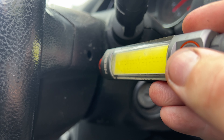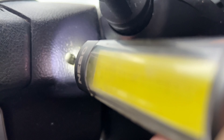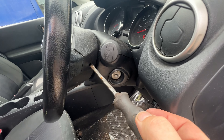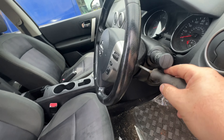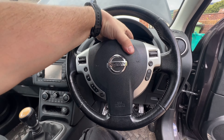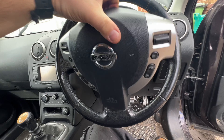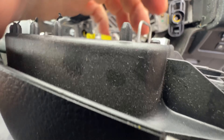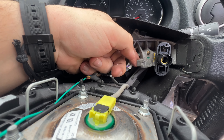On the side of the steering wheel here, you can see there's a hole, and deep in that hole there is a rod. Push that rod in with a flathead screwdriver and it pops the airbag out. With those two pushed down, just wiggle it at the bottom — and there's the airbag out. Essentially what you're doing is pushing these prongs in, getting them over these clasps here.